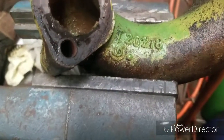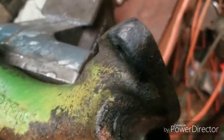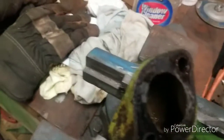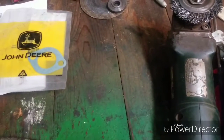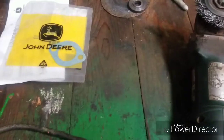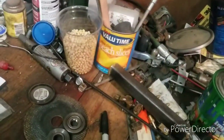A night or two later, I decided to pull this neck off the side of the head — that goes for the thermostat housing. We already had that off, but that gasket's pretty crappy too. I've got the wire wheel on the grinder and I've already cleaned this gasket surface up. I ordered the thermostat and the thermostat gasket today, so I should have it by next week.